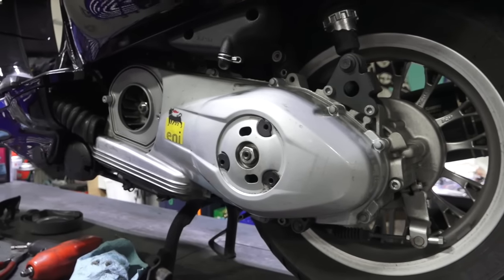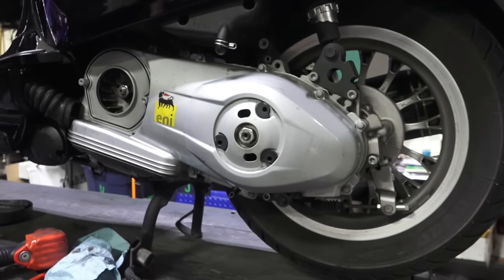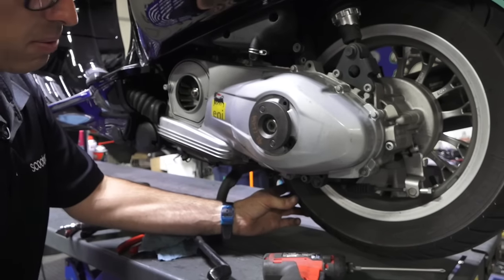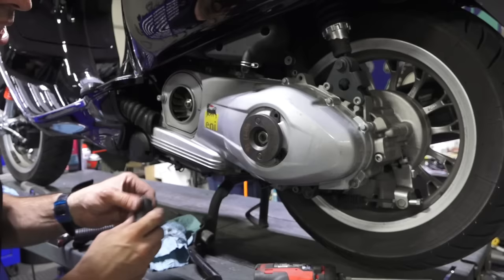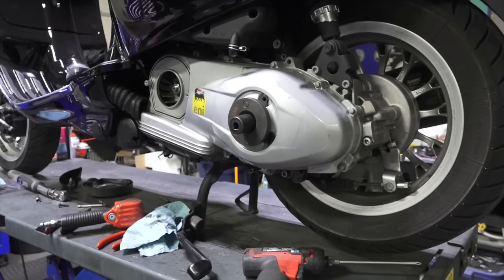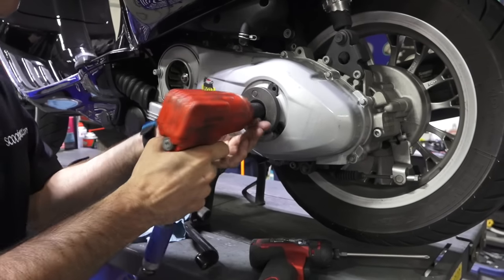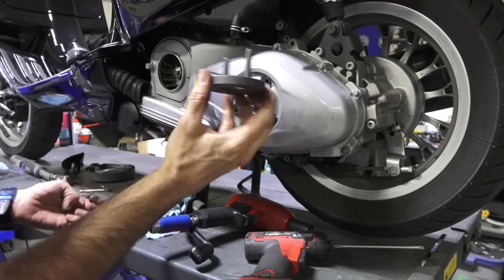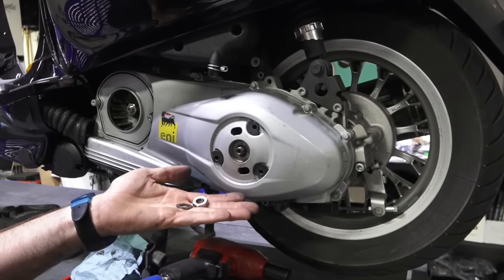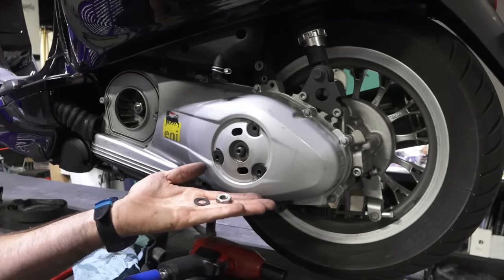One last thing to take off: you can use the variator tool — that's the clutch holder, tool ETC — which locks it in. You can use a 19mm socket and wrench to break it free. I'm going to cheat and use the air tool to zip it off. You get the nut and this little black flat washer — that arrangement is identical on pretty much all Vespas. On the 150 three-valve, they use a slightly thinner nut with the same pitch, so keep that in mind.